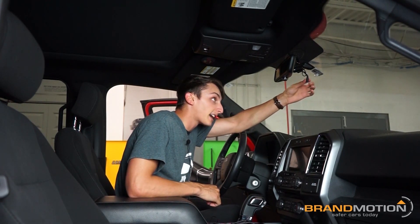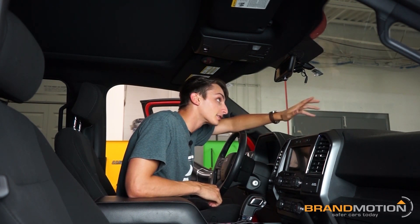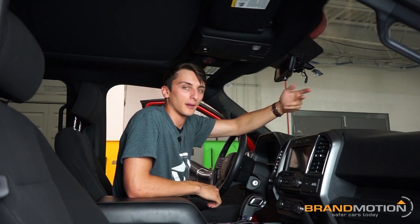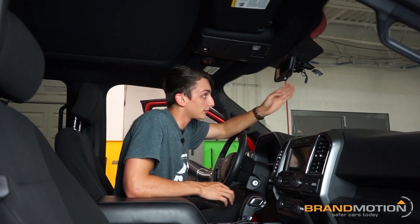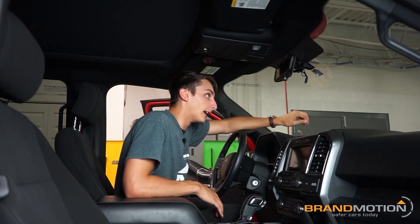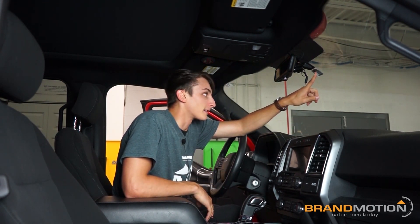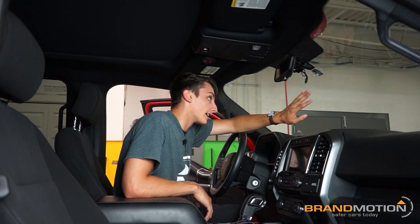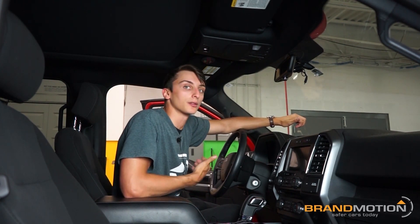I went ahead and ran my power harness for the ADAS coming from up in the headliner. Here's where you have some flexibility as far as mounting. I prefer to mount it dead center right below the mirror and almost hide it behind the mirror — I'm not much interested in seeing the actual screen of the ADAS. But if you do want to see that screen, you can mount left or right — there is a protocol in the calibration that will call out left or right. I went ahead and mounted mine dead center just below the mirror mount. It's just some double-sided tape — I made sure I cleaned my windshield with a little bit of alcohol, let it dry, and then went ahead and mounted it. Now that it's mounted and my power is here, I can put the ADAS up there and we can start going through the calibration instructions.